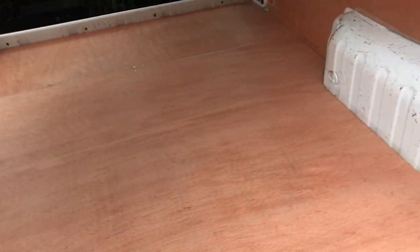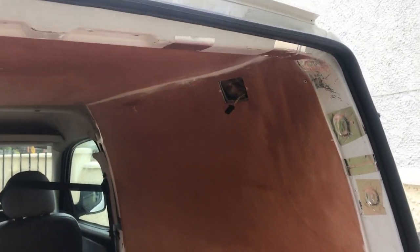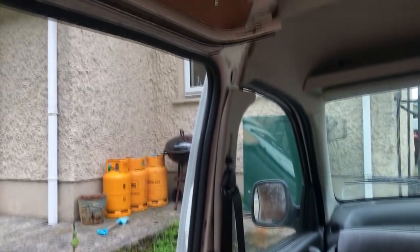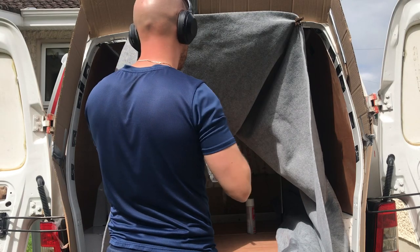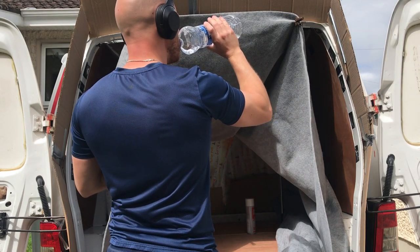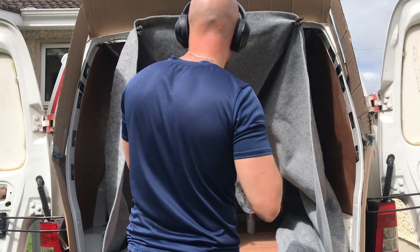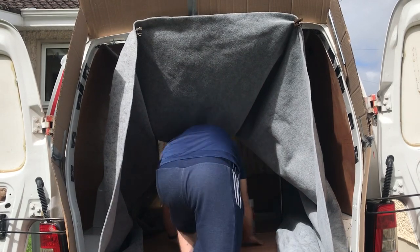What I've actually done here is I've used aluminium foil to cover up all the holes in the van. The reason is because dirt will permeate through the holes if you do not cover them. Aluminium foil is a great way of doing that. I've done it all down the driver's door, fillers, everything. I've covered up as much as I can here for the carpeting, because I don't want to get any overspray in the van. And here we go, got to start the carpeting.